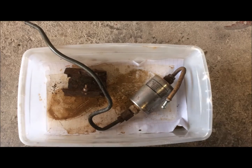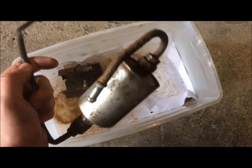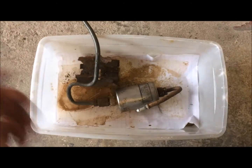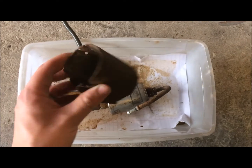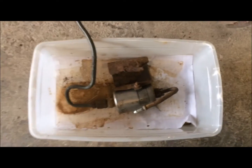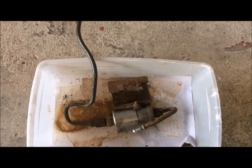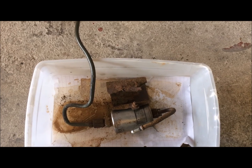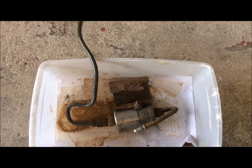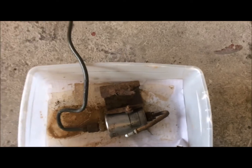Okay, so I've gone away and thought about it, and I've decided that obviously this is all too far corroded and has a kink in the pipe, so I can't go ahead and use it. The bracket's shot, so instead of buying the three individual parts and replacing it at a later date, I'm just going to crack ahead and use some inline filters and some rubber fuel hose pipe, and make up my own little system in the boot area next to the tank.